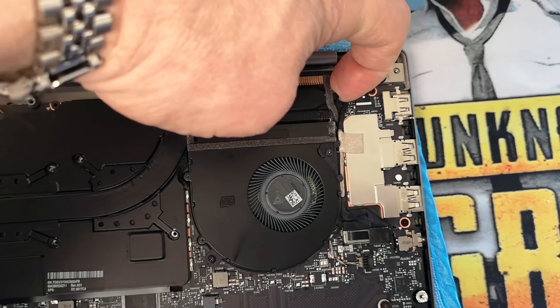What I've done is I took off the heat spreader — have a look at this damage. It is eating through the copper coating. Now, I knew if this heatsink was not copper that it would eat through it, and I scratched it, but I mustn't have scratched deep enough because it looked copper when I scratched it. But still, it ate through that coating no problem. So make sure if you are going to test whether your heatsink is indeed copper, scratch really deep.